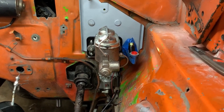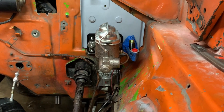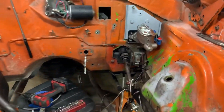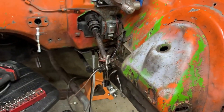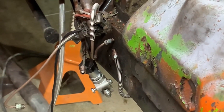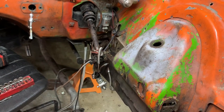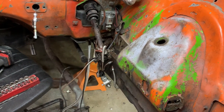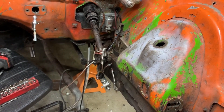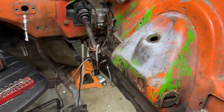So that's where it's at and everything's looking good. I'll probably start wiring, then plumbing for my fuel — maybe some fuel issues I've been dealing with — and brake lines. I'm going to get rid of that factory brake line there and the junction business down here, the factory distribution block that was here. You can see I've got a proportioning valve there. Since I've swapped the front brakes and gone to something entirely different, I really don't need that rear distribution valve — the only thing it really does for me is turn on my brake light in the dash, which I don't need. So I took it out; it's not doing a great job, it's taking up a lot of room and it's ugly. Trying to simplify things — but there it is so far.